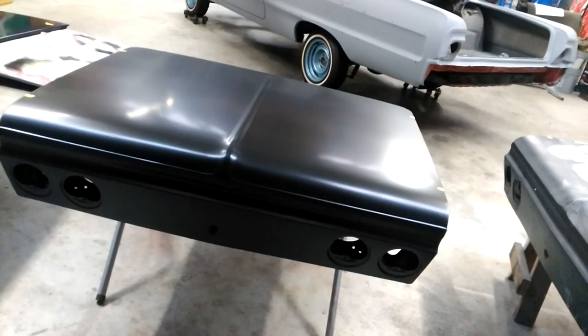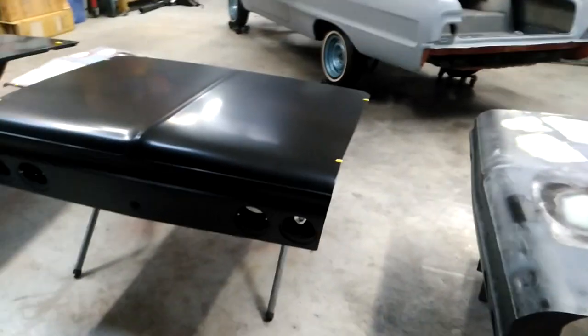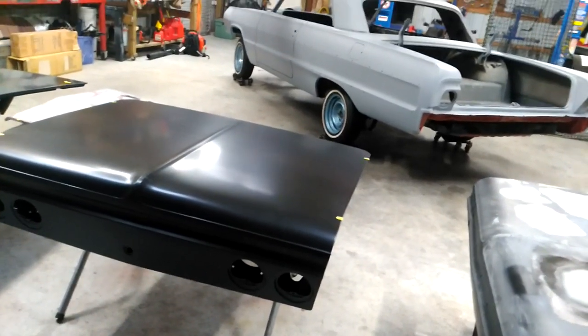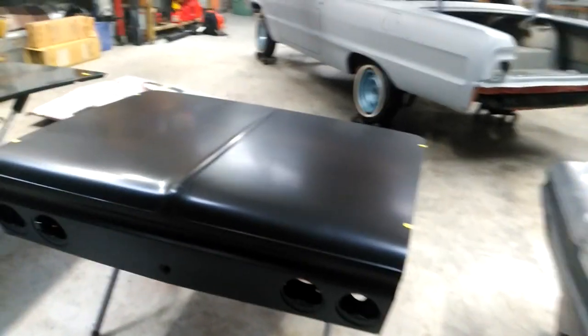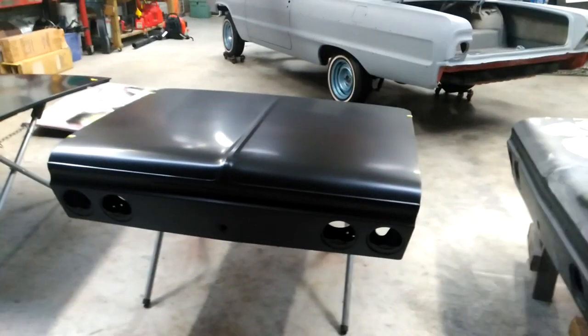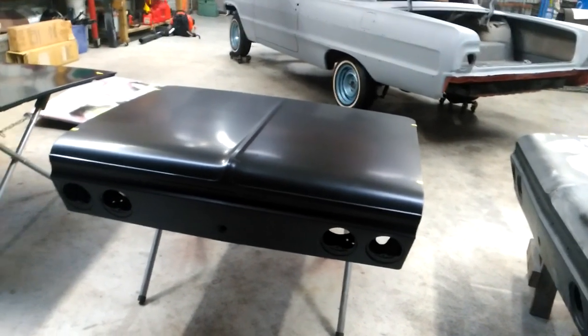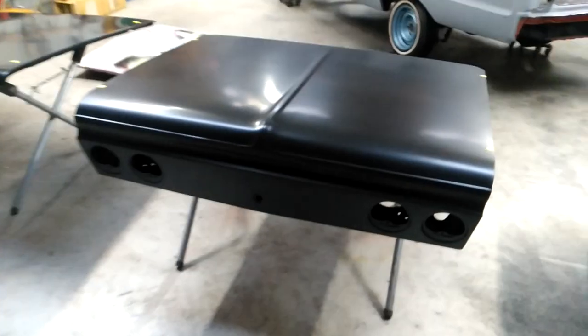The original seemed heavier, but there isn't a whole lot of adjustment on the trunk for me. I'm hoping I get lucky because if whoever made these things took an original trunk like mine and made the repops from that, this thing should fall right on my car since the quarters are original. Everything is original to the car — no sheet metal has been replaced. So in theory it should just bolt right on. I can understand if you have different quarter panels, repop trunk hinges, torsion bars — all kinds of Frankenstein things — you might run into a problem. But I'm hoping this thing bolts on, closes, needs minor adjustments and holes drilled. That'll be a win.